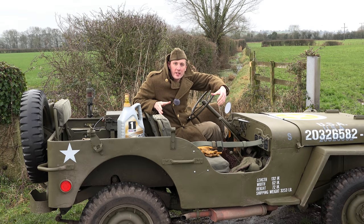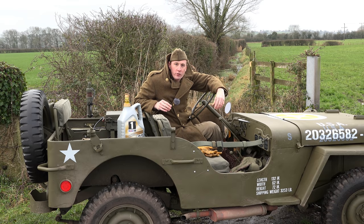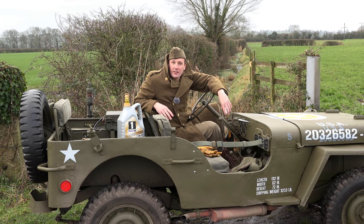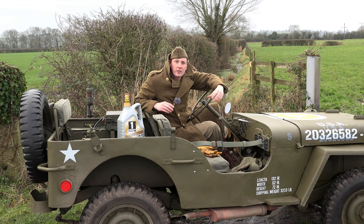Hopefully you're following me on multiweight. You can see there's really no argument against using a multiweight — it just makes sense. Its cold-flowing and warm-flowing characteristics are fantastic, much better than using a straight weight. If you disagree with my oil opinions, I think you can't argue about multiweight oils. They are good. You don't need to worry about using a low weight oil like a zero in an engine like this — it doesn't cause a problem. So moving on then to synthetic oils, and using them in this engine — the conventional wisdom is you can't do it. They're not built for it, tolerances are different, it won't work. And I've been using one and we've done the 500-mile oil change, so let's see what we found and whether this oil worked.